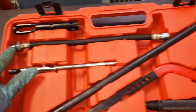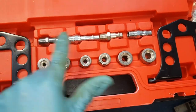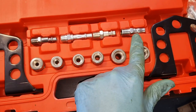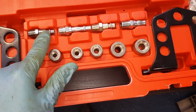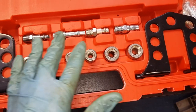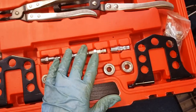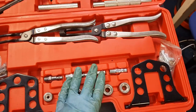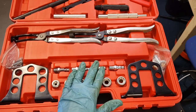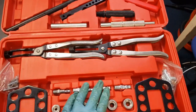There's an adapter here with two different threads on it which has a connector that can go onto different fittings to go onto airlines, so the engine can be put at top dead center and you can connect it to an airline and then pressurize a cylinder so that will keep the valves closed. That means you don't have to remove the head to get the valve springs off, so you can change the springs if required, or the retainers or the oil seals on top of the valves, more commonly.